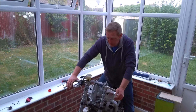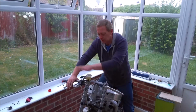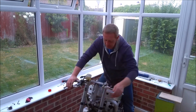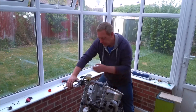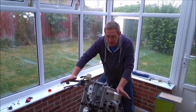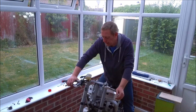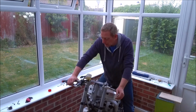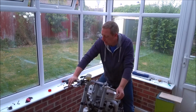Normally they're nowhere near this trouble. I think it is just because we had a completely rebuilt master cylinder. Lines were on with air in them, and obviously completely rebuilt calipers themselves, again, full of air, no fluid in there, and it just took a little bit of a while and effort to get everything through. But as you can see, I've got a nice firm lever.